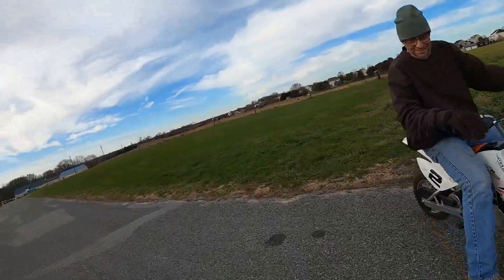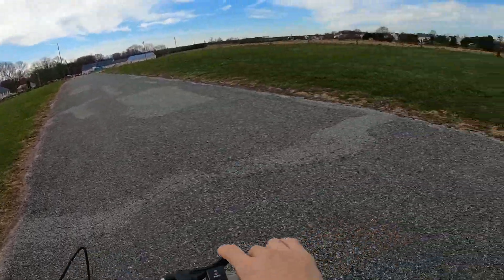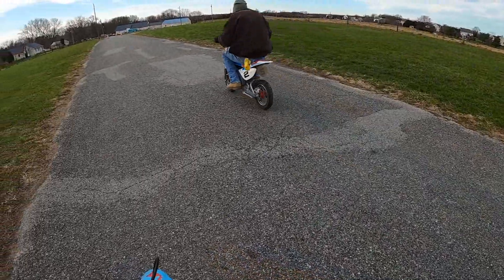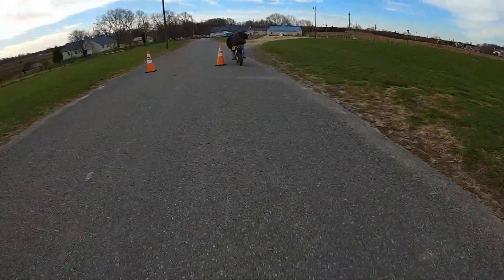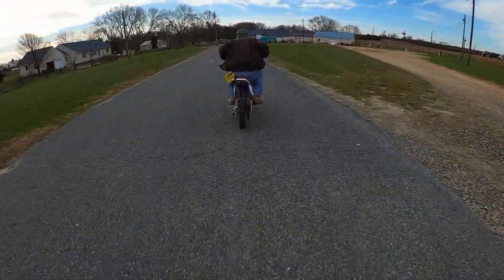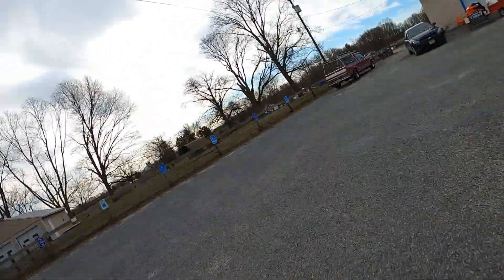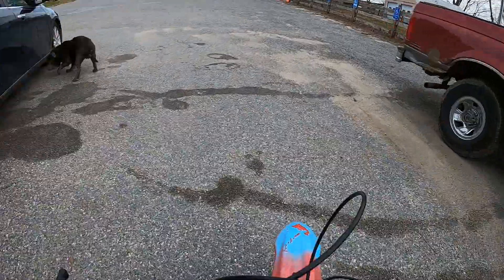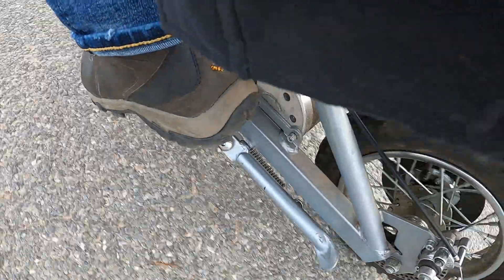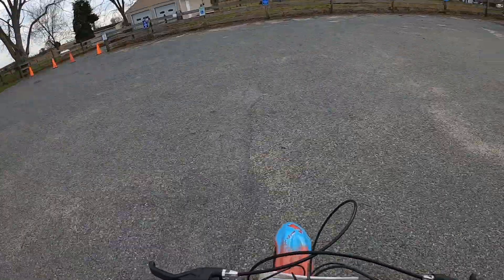It's a good five miles an hour faster. Now we're doing one more pass downhill — I'm going to give JJ a three-bike-length head start. My dad has maybe 10 pounds on me. I need a couple more miles an hour to get a longer run. But you're at least going to be able to pull uphill at your old top speed — I definitely recommend this. If you go ahead and swap in a 48-volt speed controller, you should eliminate that whine at low RPM and even gain a couple more miles an hour.